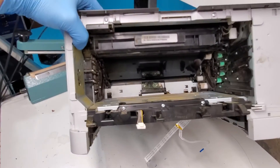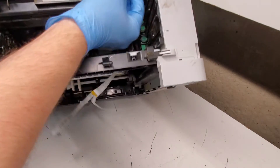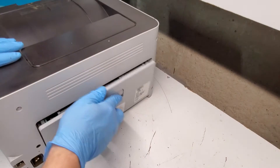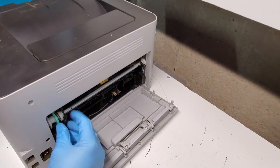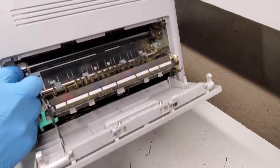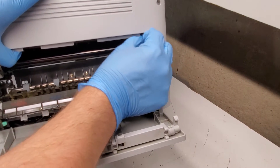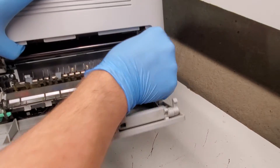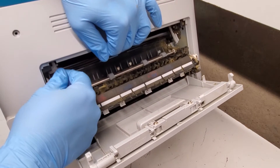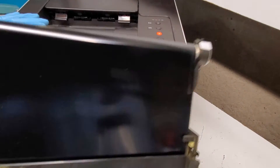So this is what we have inside of the printer for now. We still have the transfer belt in there; we're going to remove that. Disconnect it right here, then go to the back of the printer. We're going to lower this, and then there are tabs over here that we're going to remove — they'll just go down. Same thing on this side; it's a white tab that you see right here. It goes a little bit up to the right and then down. That releases the transfer belt. Now that's out.